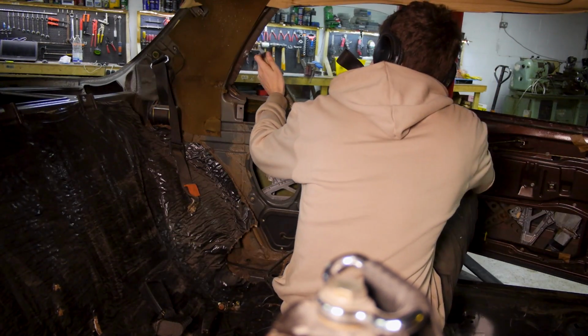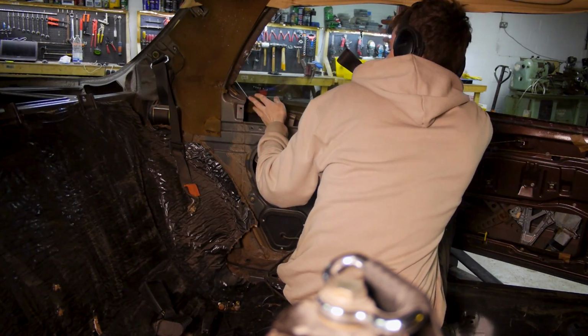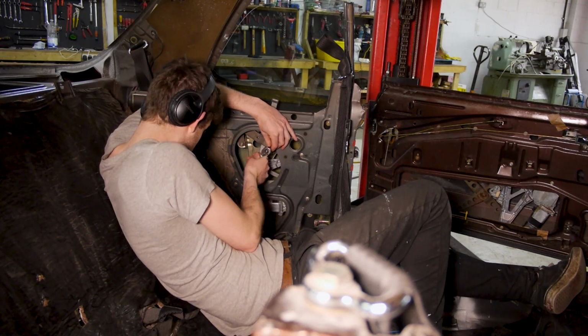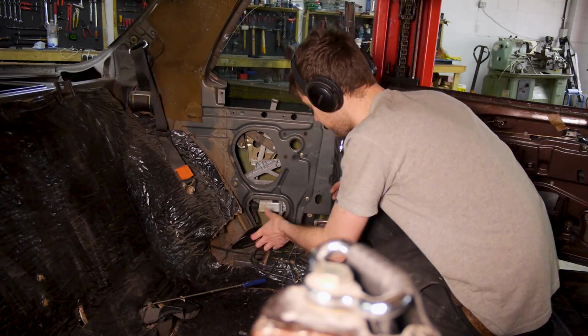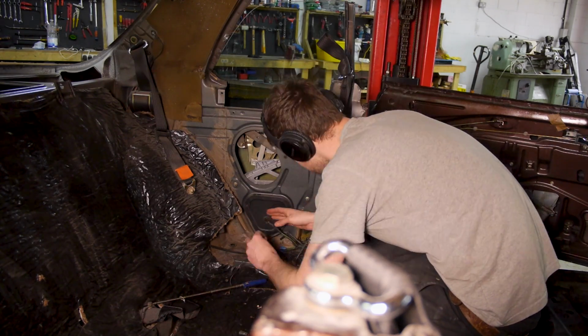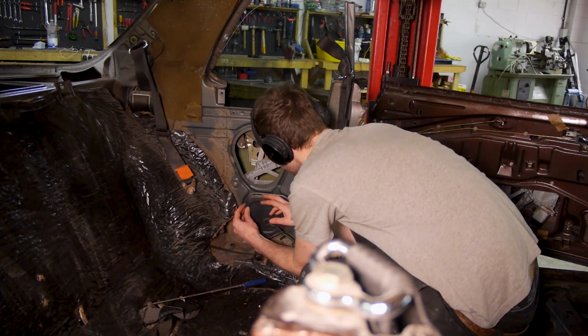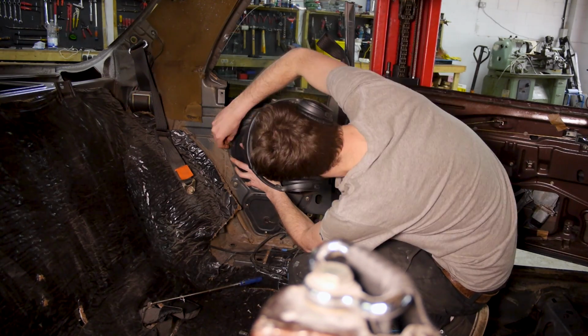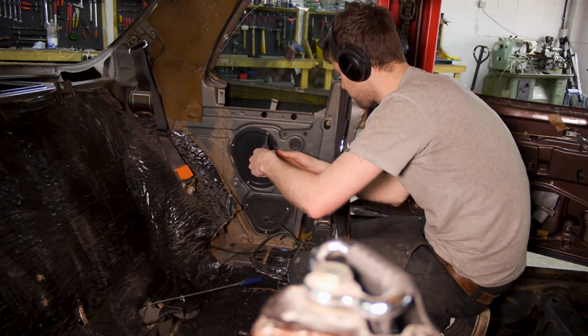Another big mistake I made was not properly assessing the damage and changing the quote to reflect the work required. And oh boy, was there a lot of work. In total there were 20 separate rust spots around the car that needed major work before I could even think about the respray. The differential and drive shafts have been rebuilt, the engine bay was way worse than we first thought, so a lot of rust removal had to be done.